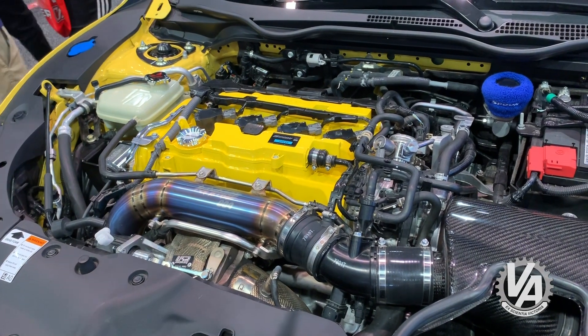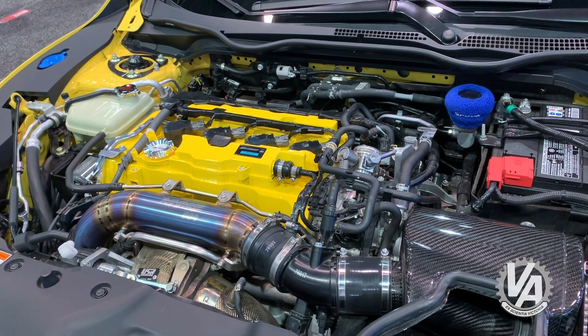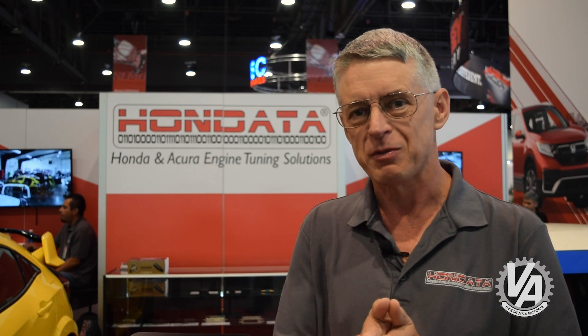As a result, we're able to provide tuning for turbos that deliver a lot more boost at a lot more degrees of efficiency, and we're able to use a lot more ethanol — we can now run up to 50% ethanol. We can actually run more than that, but 50% is optimal. Before the fuel system upgrade, the most we could run was 25% ethanol.